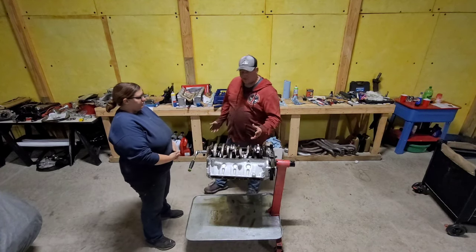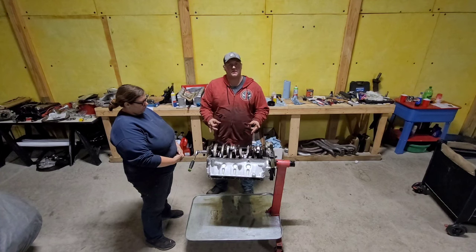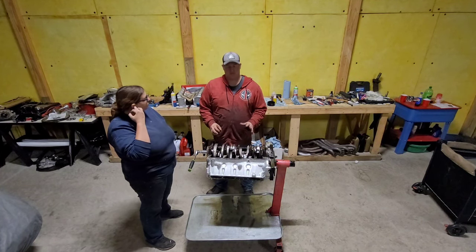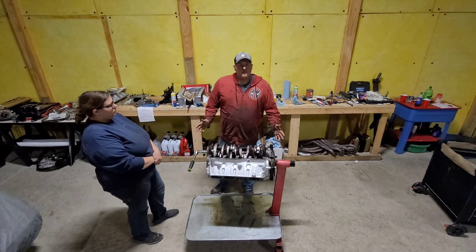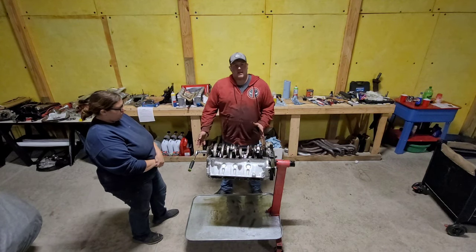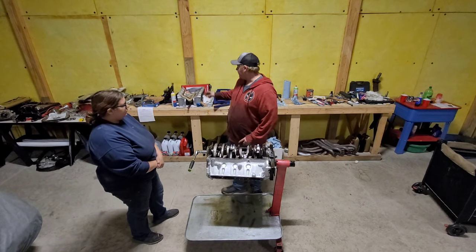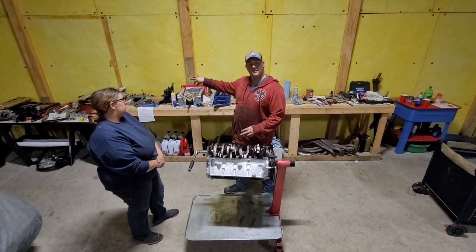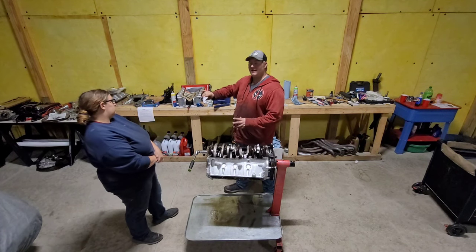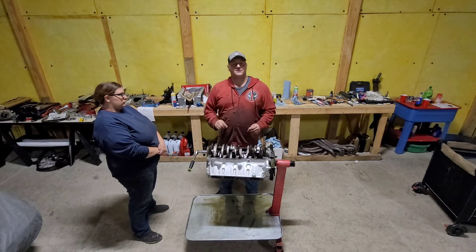Well, all right, there you have it. We have done main bearings, rod bearings, clearanced the block, clearanced our pistons again, checked all of our clearances for our bearings. Everything is assembled in the bottom end. We got a timing chain and camshaft in. Stay tuned for the next video where we're gonna go ahead and tackle lifters, spider, push rods, rocker arms, heads, head studs, intake, intake gaskets, and everything associated with that. And you'll be another step closer to having your 387 done.